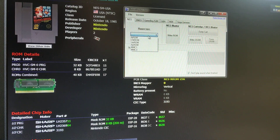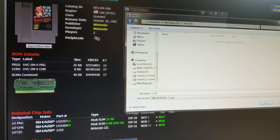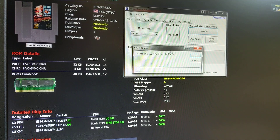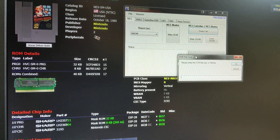First off, we're going to select mapper type — this is an NROM game — and click on Dump. From here we just give it a name: Mario Bros. Next it wants to know the PRG size. Over here on the Boot God database, PRG 0 says 32 kilobytes. It says please enter the PRG file size in kilobytes, so easy enough — we're entering 32. So we're dumping 32K.